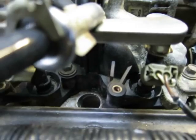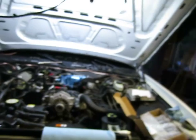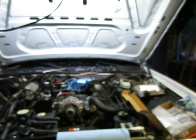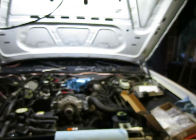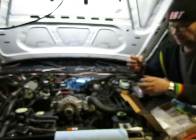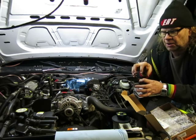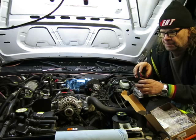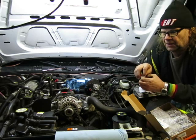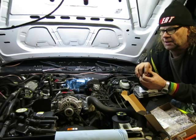And I have a fix that I'm going to tell you about for that. What it is, is it's as simple as putting in some radiator stop leak. But you've got to use a certain brand, and that's Bar's Stop Leak. The thing about Bar's is you'll open up the jar, you'll look in it, and you'll see it's this pink fluid. What it is, is it's actually like a thermoplastic, similar to Loctite.